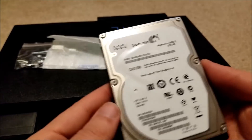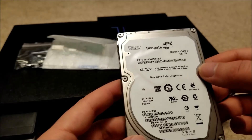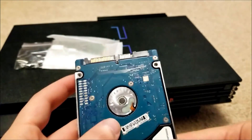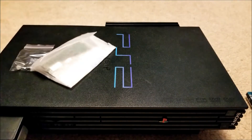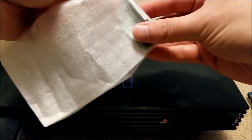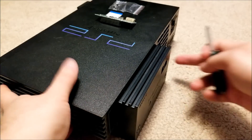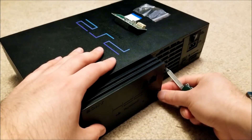So what I did was I used one of the PS2 hard drive loading Windows programs to put a bunch of my games on this 320GB 2.5 inch SATA drive. Now the problem is the PS2 is IDE only, so you cannot directly use it, which is where this adapter comes in. And this only ended up being about $11 or $12, so it's pretty cheap. While they do sell complete replacements for the original adapter, I opted for this upgrade so that I could still retain the LAN functionality, and also because I kind of like original things better.